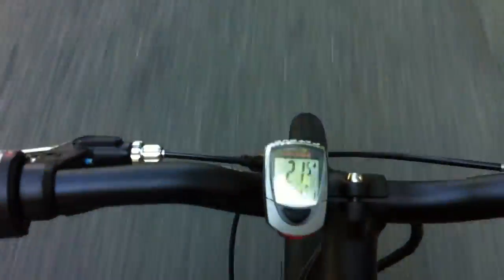I've been going wide open throttle on some pretty hilly terrain and I'm almost at 6 miles. It's performing alright, but it's a 20 amp hour pack and it's already been sagging down to 35 volts on some really big hills, so it's not operating the way it should. These are laptop cells and they're only rated at 1C, maybe 2C for some bursts. Max speed was about 33 miles an hour going downhill.